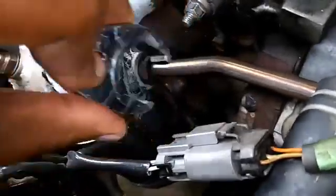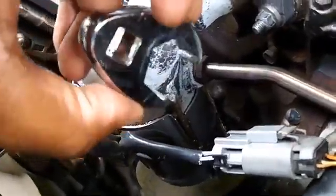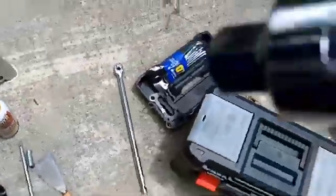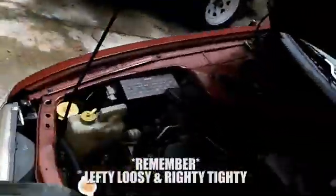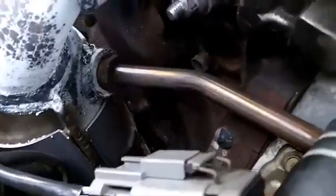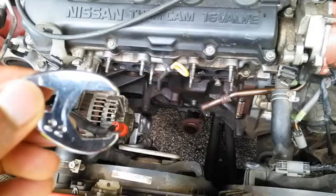but this way you can put it on the air tube, slide it back, and put it on the actual nut. When you do that, this little hole right here is just for your wrench or ratchet, you can put that in there. Then once you put that in there, it's as if you're just putting this socket on another bolt, you just turn it counterclockwise to loosen it up. Now you're gonna have to take the crow's foot on and off to be able to line it up to get back in this little small space. That way you can keep getting this in here like that and turn, because if you turn it, the crow's foot is gonna end up down here. You gotta take it off to put it back up here so you can get your wrench in there. I know it's kind of confusing, but that's what I had to do.